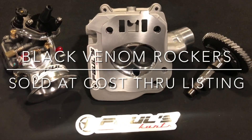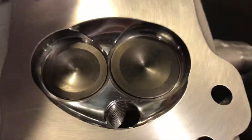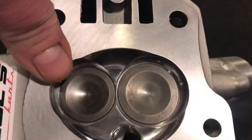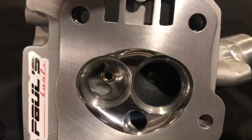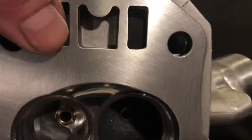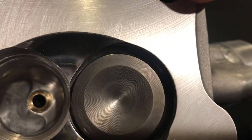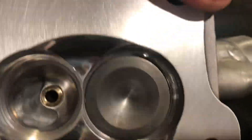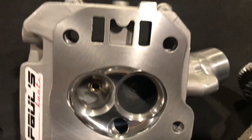The 3228 head has a polished chamber with radius valve reliefs. This is not a hemi head — a lot of people ask that, but it's not. It just has the radius valve chamber relief cut into it to unshroud the valves on the sides. You can see how close the valve is to the side of the chamber — without that radius relief cut it would literally be sliding along the side of the chamber. That cut pulls the chamber away from the edge of the valve to allow more flow around it. Picks up good numbers on the flow bench.